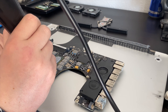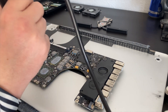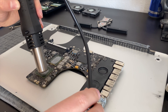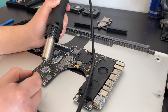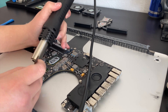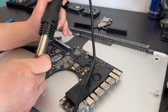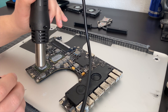With the glue removed, we can turn up the heat on my soldering station up to around 500 degrees just to get the solder underneath the GPU melted enough to where it's making contact again. I don't know what the problem is with these GPUs but I know that heating them up works because people have put them in the oven and it's worked. I just wanted to take a different approach because putting the whole motherboard in the oven doesn't make me comfortable.